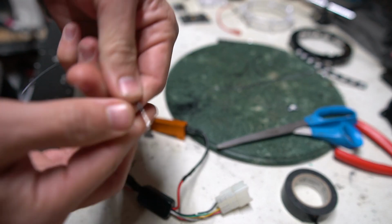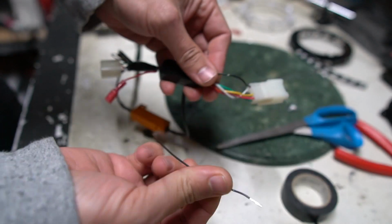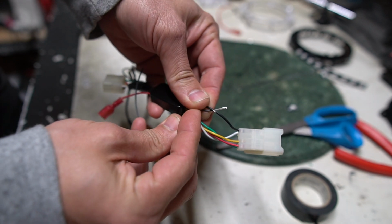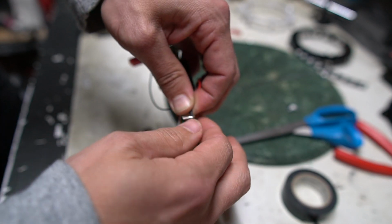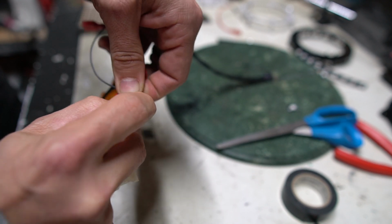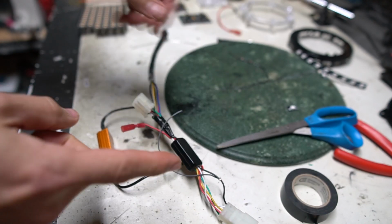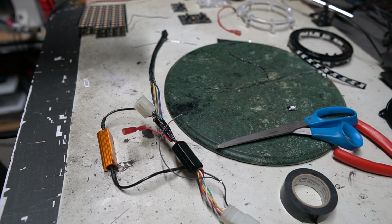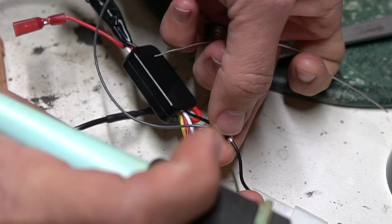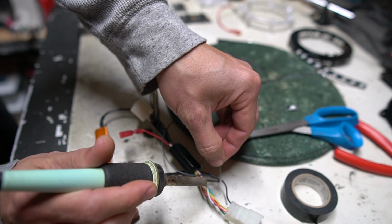All right, so let's say this is the wire that I'm going to solder to. All that I want to do is take this wire that I have here that's going to go to whatever, and then wrap it around that. Depending on which way I want the wire to go, I could bring the wire up from the bottom or the other side. And I can just wrap that metal on metal right around at that joint, make sure that it's nice and solid. And then instead of just taping that, which is what I see boneheads do all the time, solder that thing. Make sure that the solder connection is nice and secure. In this case, I can see that there's a little piece sticking up. Right now it's not soldered, so that's not going to be all sharp and stab me or anything. So I'm going through, adding my solder right now.